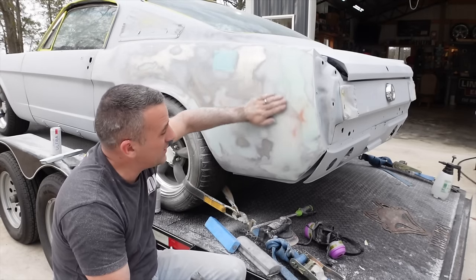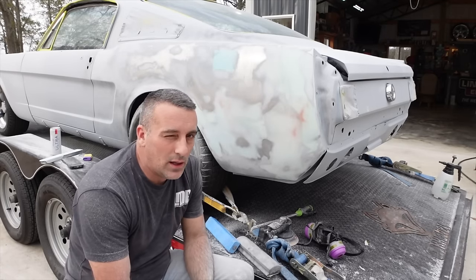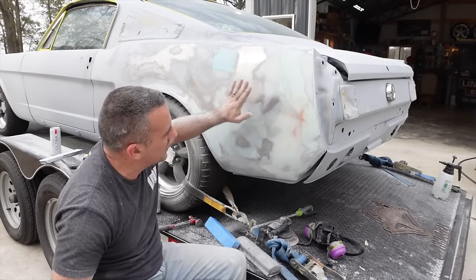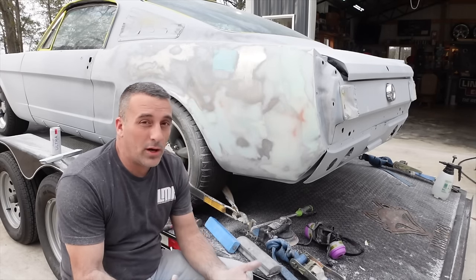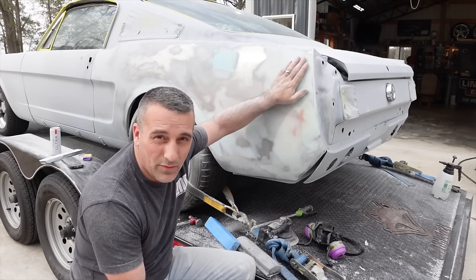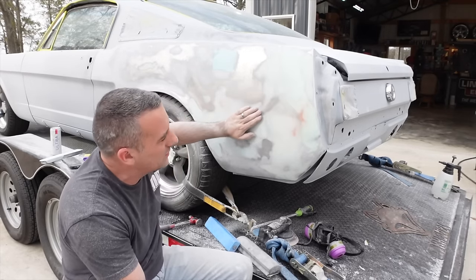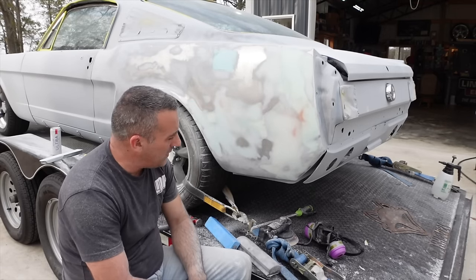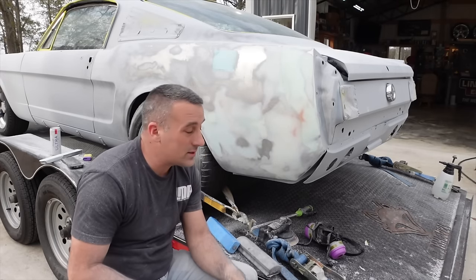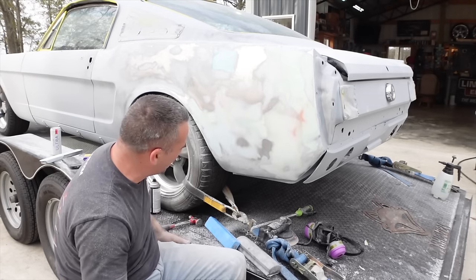That feels pretty good — actually real good right now. You could come in with some poly glaze, icing, or a really lightweight filler and smear over this and block it back out. I'm not a professional — I've told you all that — but we will get this car flat. This is what it's going to look like if you're doing it in the driveway: different colors of bondo and primer and whatever you've got laying around, and that's okay. Let's go ahead and pack a little bit of filler right here again and see what this affects.